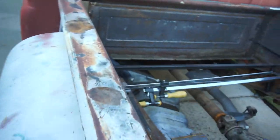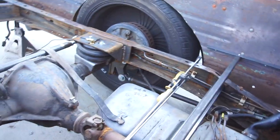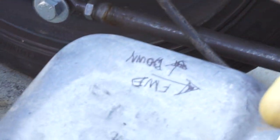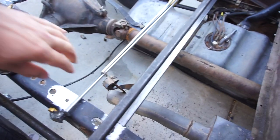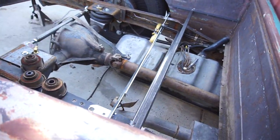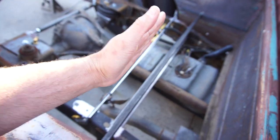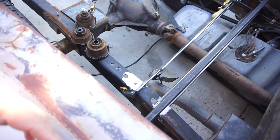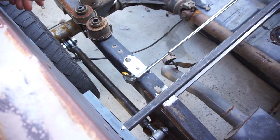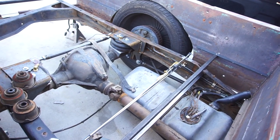For now, I took off the tray on this side and took out this cross member here. I just ground off the rivets there and over there also, because I needed to bring the gas tank forward and down. This is just temporary in there. I got burnt out. When I took the rivets out and basically had to slide that cross member over, then twist it and pull it out, it spread — had to spread the frame. It ended up spreading the frame open about a quarter inch.